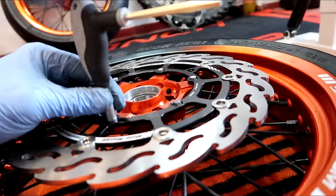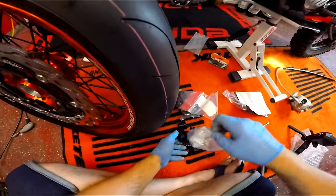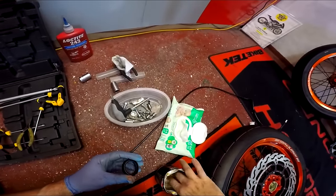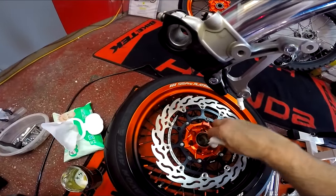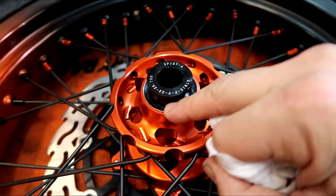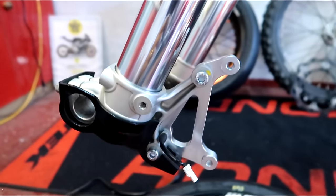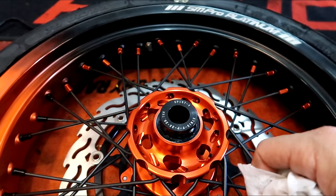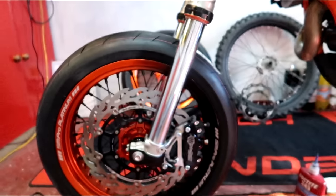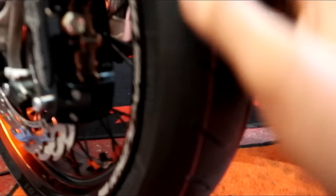You don't need to go bananas on these little bolts. Comes with a selection of spacers — I guess one's for the back wheel, one's for the front. Plenty of grease, plenty of lube. Spacers in — I think they're the right spacers. Dust seals greased. 22mm spacers — they give you all the various options. I think we're ready to get the wheel in. Take the caliper off first, because the wheel won't slide in with the caliper on — it's much wider than standard. Wheel in. Starting to look very cool. Caliper nicely centralised on the disc — just exactly central.